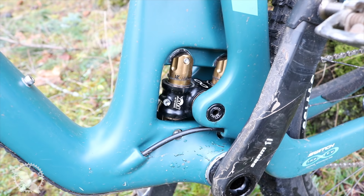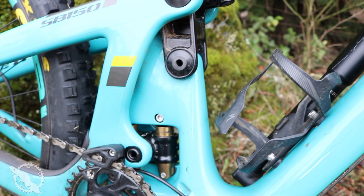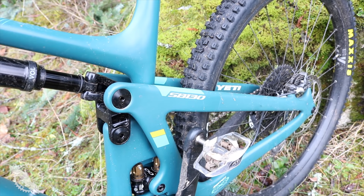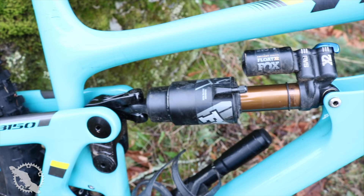There's been a lot of revisions with these bikes this year, most noticeably in and around the Switch Infinity Link area, which is Yeti's patented platform for pedaling. It includes a pivot floating on two Kashima coated rails that help the bike not only pedal very efficiently but become very lively when going downhill. There's a new shock extender which allows for better kinematics and progression on the bike's leverage ratios, and as a side benefit allows for a water bottle inside the main triangle.